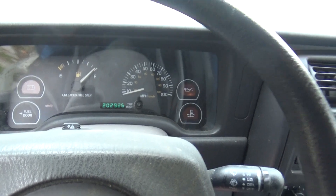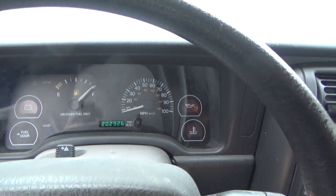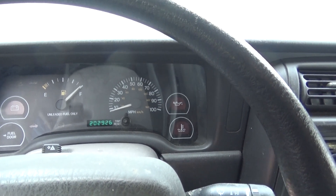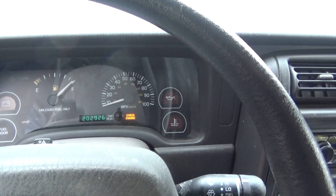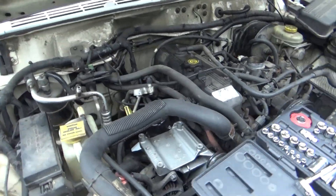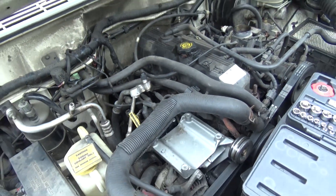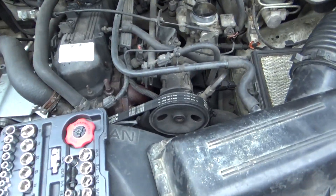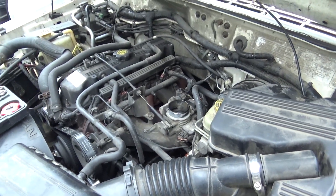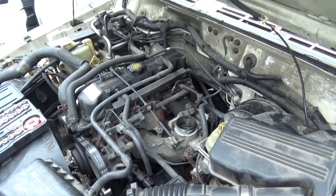This has been a really good truck — it's got 202,000 miles and he's driven the crap out of it. I had him fill it up with high-test gas just in case. Most of the time when you're looking at something wrong with your vehicle, your best diagnostic tool sits above your head between your shoulders — you've got to think about what's going on. The Jeep doesn't sound like it's getting any fuel or maybe spark, so we're going to go to the easiest thing first. Start checking spark, fuel, and then go on from there to computer, timing chain, all those other things — but go to the easiest stuff first, because why would you want to go through the hard stuff and find out it was just a loose wire?